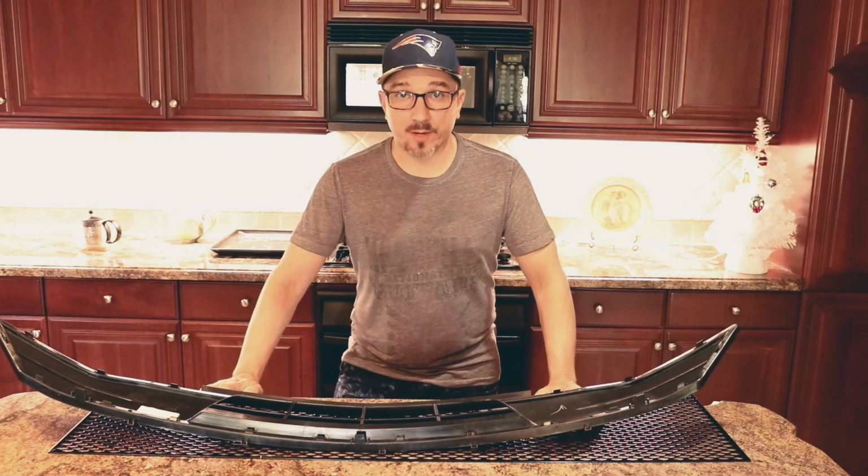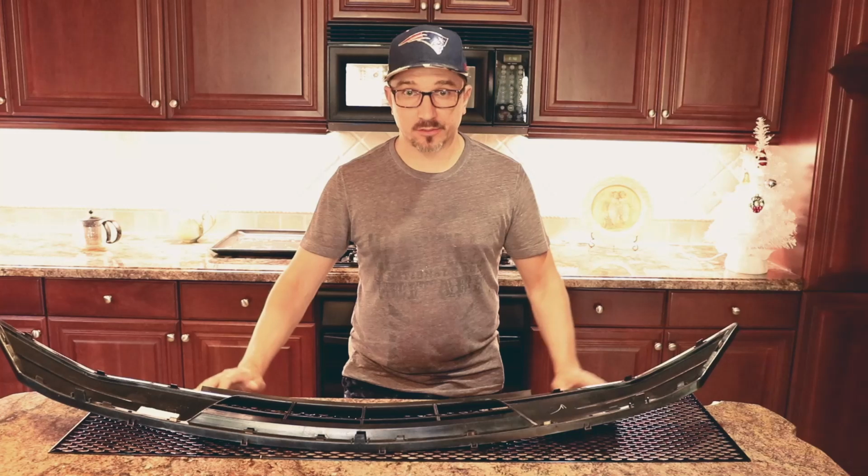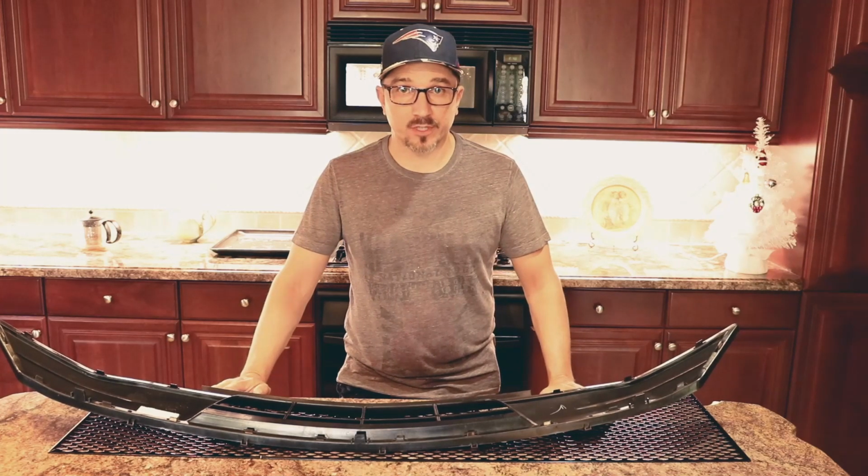Make sure that you take proper measurements beforehand, that you're going to have enough grill mesh material to cover the area that you're trying to fabricate. So with my three sections traced out, I'm going to start cutting them out one by one. I've already started on this end over here. I'm just going to work my way around and see if I can manage to get those three pieces out of this one mesh.